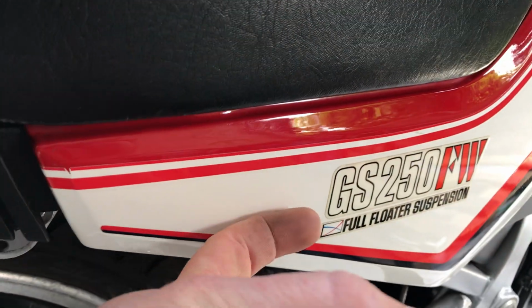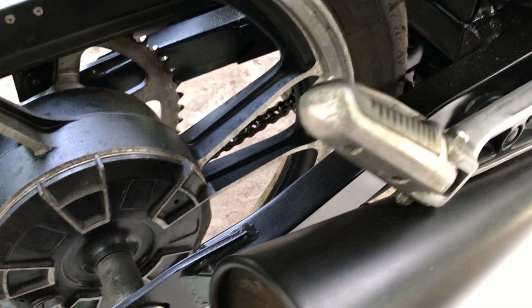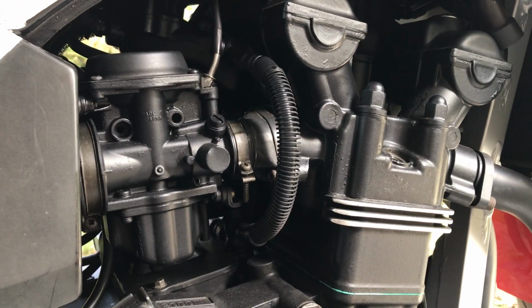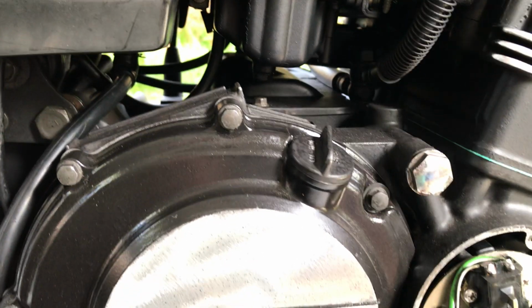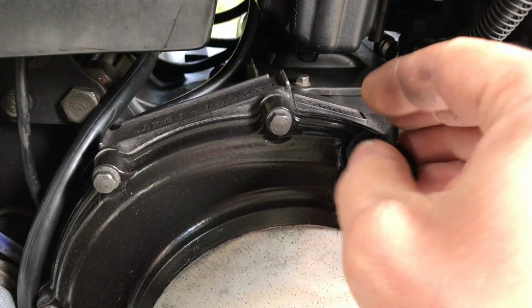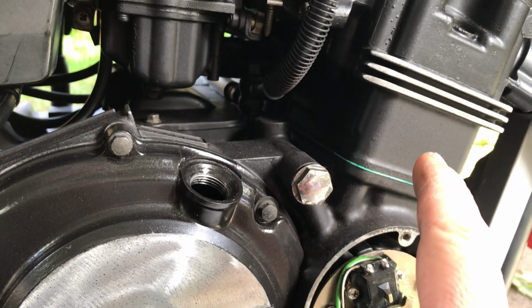One is the intake, somewhere on behind this. The other spot is the exhaust. If you hear no air leak on the exhaust and on the intake side, it means your valves are good. Now, the third thing, and that's your worst nightmare, is to hear hissing if you remove the oil cap. If you hear hissing here, it means your piston rings don't seal.